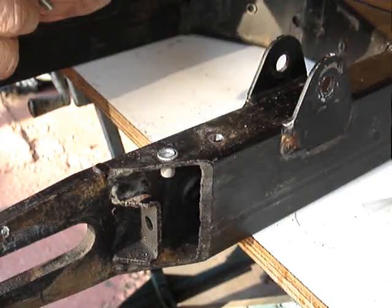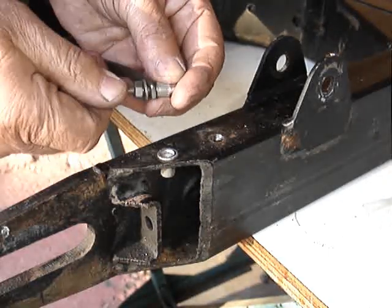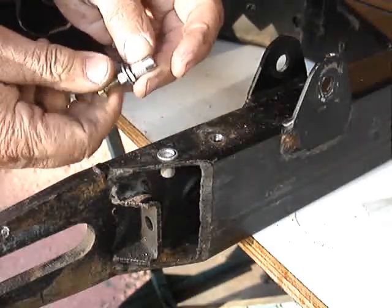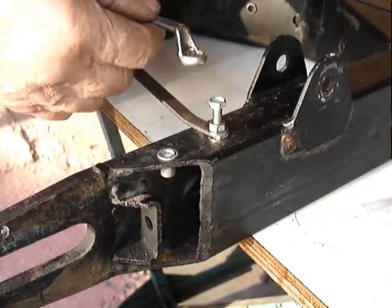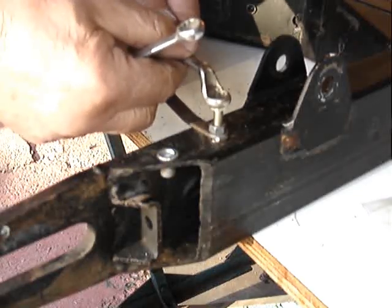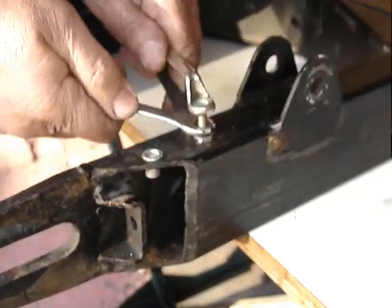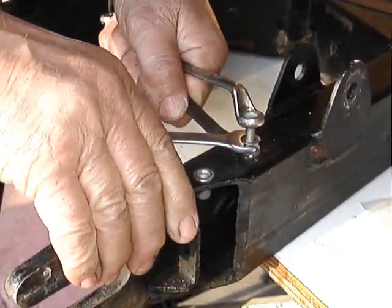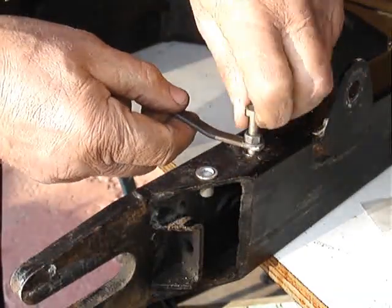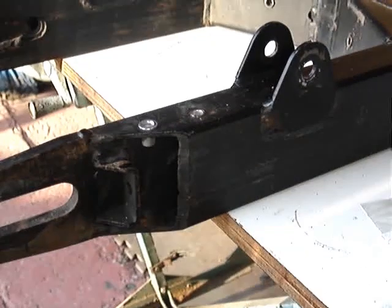You'll recall that the hydraulic pipe to the back brake was in a clip which had to be cut to get the wheel out, so I've decided I'm going to replace that with a rivnut. Elsewhere on my site you'll find the instructions on how to make and use a little homemade tool for fitting the rivnuts. There's a nice new rivnut pop rivet - so now a quick coat of paint and we're ready to put that back in.